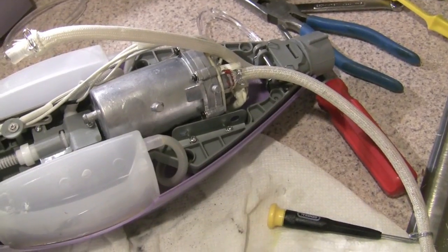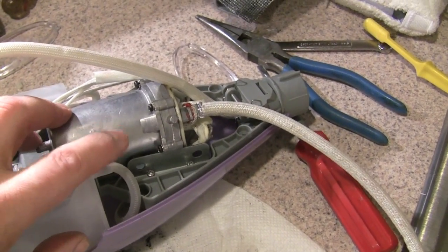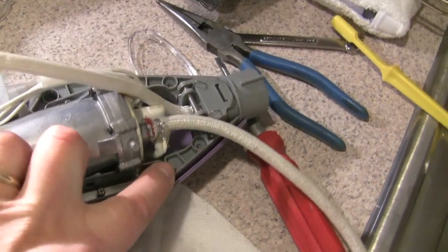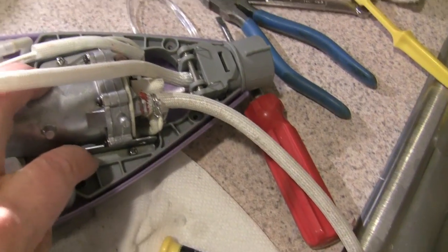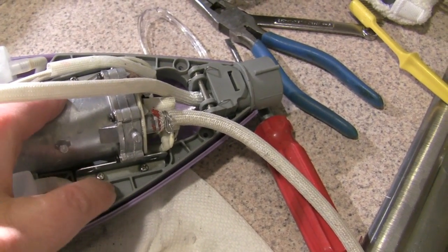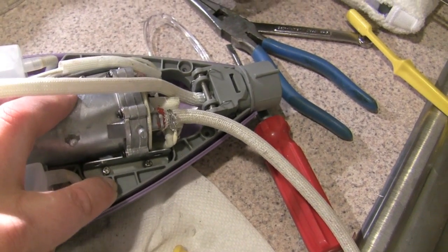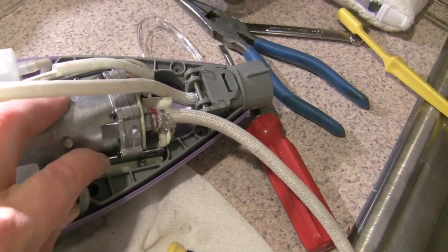So here's a trick I found out: the body of this heater core has 2 pins that get suspended between 2 angle brackets on either side. I loosen the screws and do not remove them. If you remove them, you'll discover a heat washer that has been glued to the plastic underneath. The glue is kind of old, so the heat washer probably gets lost, and it's a little bit of a job to get them all back in.